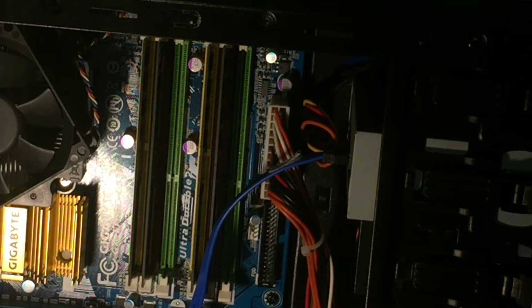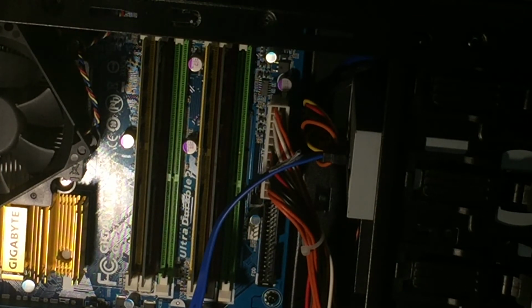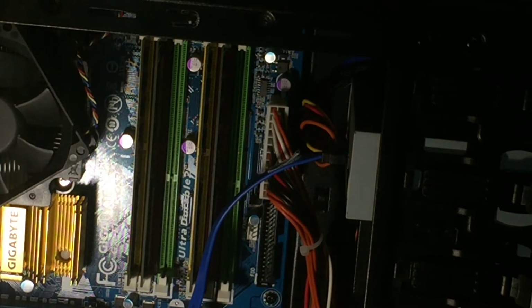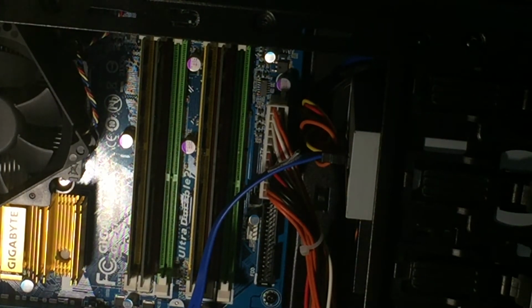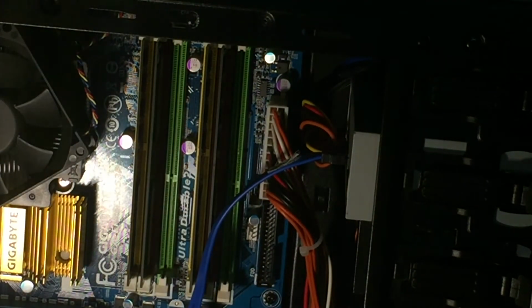Reset switch is the second one. So I plug that in next to the motherboard. It will not matter what orientation the connectors are in. Power switch goes on top of the reset switch, and then I'll put those together and plug those in, like so. And I'll put those through like that.